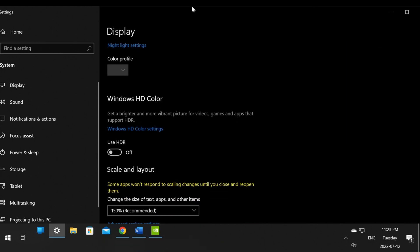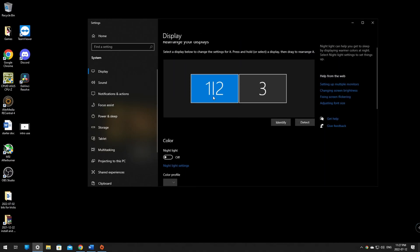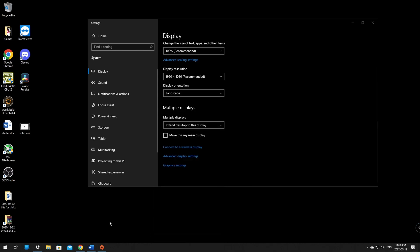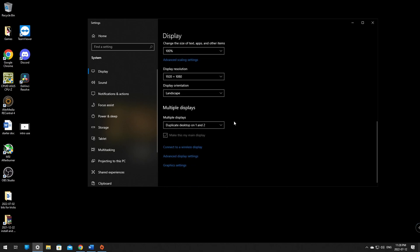It might take a little fiddling with settings. Make sure all displays are double-checked after applying changes — the size can get pushed up to 4K if your monitor isn't built for it, so you'll have to fix that. Make sure it's at 100% recommended scaling and your display resolution is 1920x1080. You can also clone the display directly in Windows by pressing the Duplicate Display shortcut.